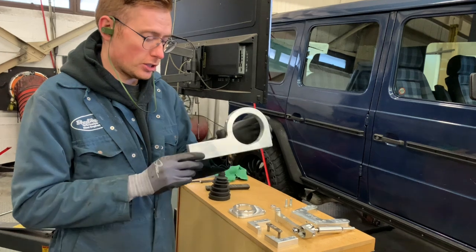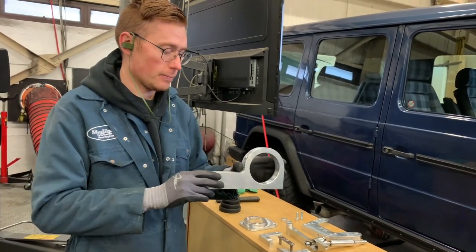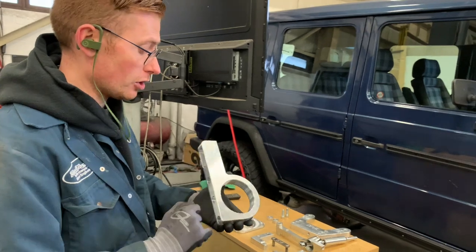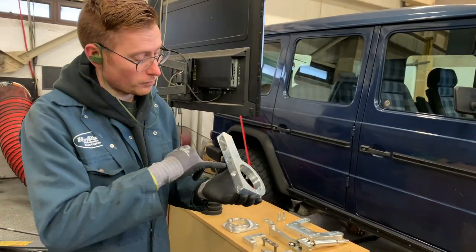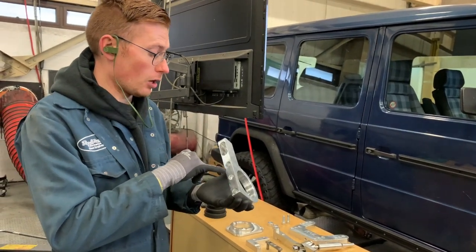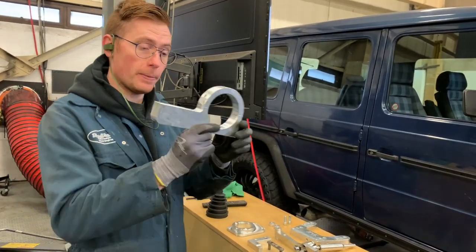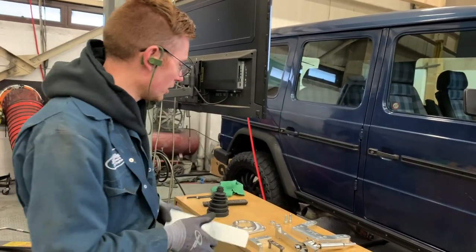So how it works is you put this into position, you get everything aligned, how you're happy, and then you tighten the two bolts which clamp it tight to the tube. Then you simply put a hole through the tube, I think with an 8.5mm drill bit, and then you go M10 tap into the steel tube, and literally a small bolt then pins this so that it can't turn, bit of Loctite. And then you're never going to have an issue.